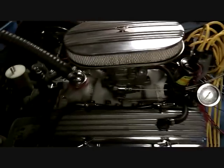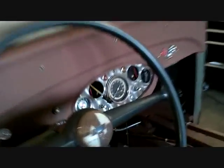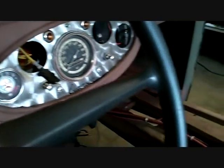Let me make sure these suckers are all tight. The choke wire is still hanging here — not that I need a choke in the summer. I should probably just unplug it and set it to be open all the time. The throttle's very weak. I need that secondary spring — I only got the first one. I need the big one that goes outside of it. It's very easy to put this thing to full throttle. I want my block-off plate. I want my exhaust. Wouldn't that be cool if we had the exhaust going to the cherry bombs sticking out the side? We've got to quit talking and start doing. The guy that has my exhaust — they fired him. Awesome.